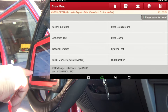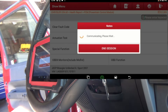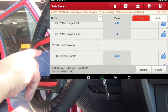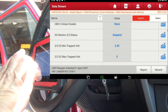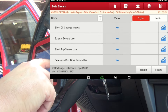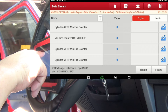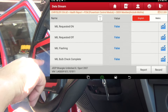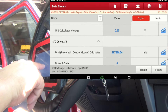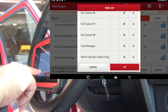If you scroll all the way down, look at the lower left corner — you see OBD2 monitors, which includes misfire. Let's go into that. This has got a bunch of useful information — pages and pages of what a lot of people would look at and wonder what they'd ever use it for. Well, let's scroll all the way to the bottom. Which cylinder is misfiring? That's what I want to see. If you click the T, it brings up the whole list, and the very bottom one is which cylinder is misfiring.